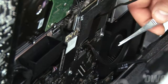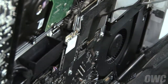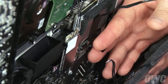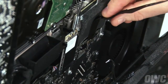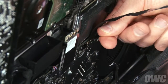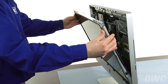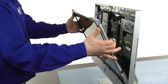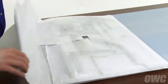Moving towards the right side, lift the display power cable up and out much like you did for the vertical sync cable. Finally, detach the display port cable by first opening the handle by lifting the black plastic tab, peeling the cable away, then lifting the connection straight up and out. Keeping your hands on the outside edge of the display, you can now lift it up and out of the iMac and place it in a dust, static, and oil-free place. We recommend using the bag that covered your iMac when you first purchased it.